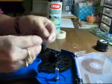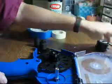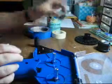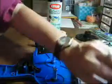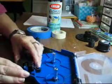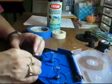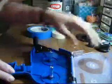By the way, there were two washers that went along with the screws for the gears, so I put those with the screws and put them in a safe place where they won't be knocked over or eaten by your dog. I removed all these, then took the cover off the handle. This trigger comes out pretty easily — it's just held in by a little spring. Make sure you don't lose the spring.